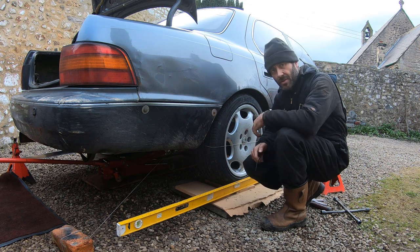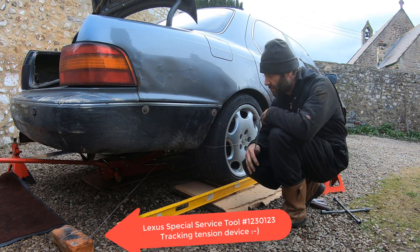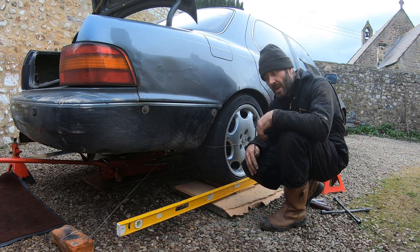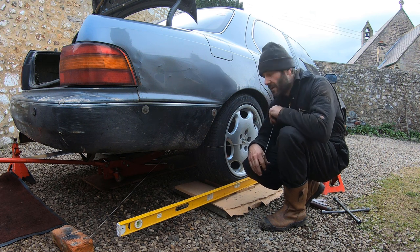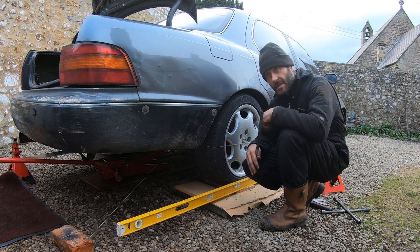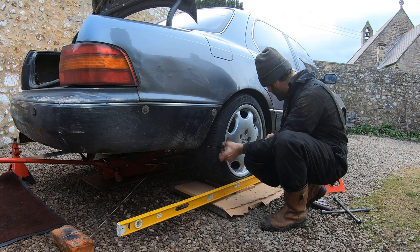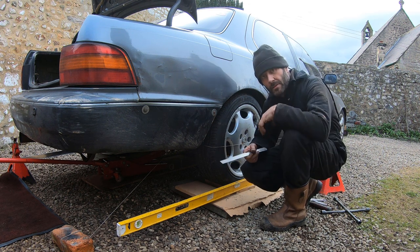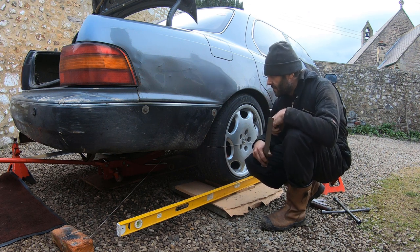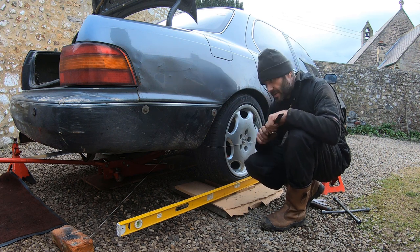The strings are parallel. The track on this car is 40mm narrower at the front than the rear, so I've put 20mm wooden spacer blocks in the front — one each side. The front tracking is okay. Looking at the string on the rear: we're 18mm toe-in on that side and about 4mm toe-out on the other. Ideally I want them both parallel. We've also got one and a half degrees of camber on this side and half a degree on the other — so let's do some adjustments.